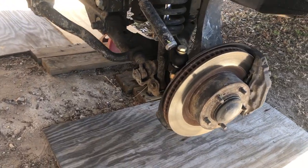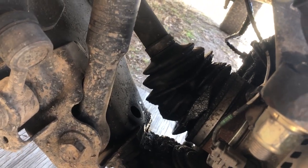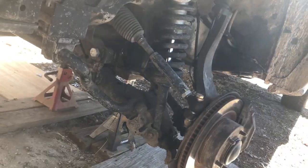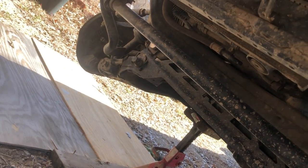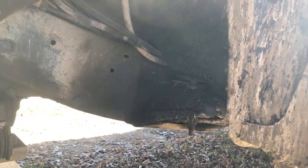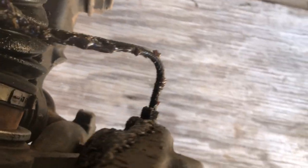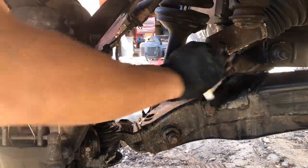This pair of CV axles in the video are from NAPA — they're called the extended CV axles and they provide higher articulation. They're slightly more expensive than the parts store OEM replacement CV axles and they're an inch and a half to two inches longer than the OEM ones. This is what I had available back in July when I was stuck in Colorado because my OEM CV axles were having problems due to my lift kit. The driver's side finally broke down when I was going over a ditch with the steering wheel fully locked left and four-wheel drive engaged — it tore apart the outer metal assembly inside and tore the boot. Luckily it was still attached, giving only a small grinding noise in two-wheel drive, and that's how I made it home.